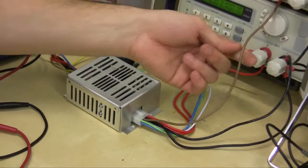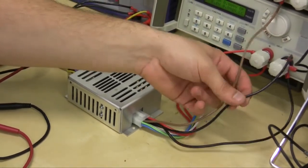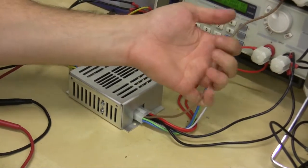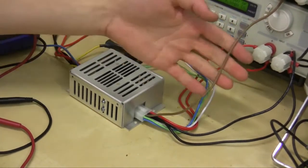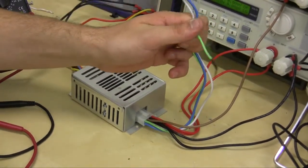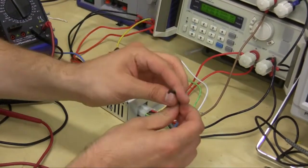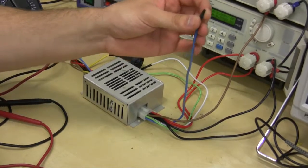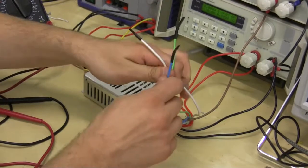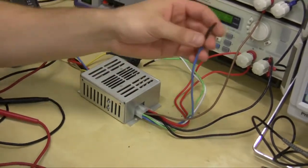The brown is the secondary output, and usually you'll use one of these ground wires or black wires in conjunction with the brown wire. The brown wire is the positive whenever you connect these. These I'm not using momentarily. If you have amps, you would want to use the blue wire, which is remote on. I have all these temporarily isolated so something bad doesn't happen to my car, since I like it.